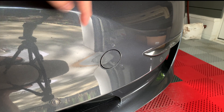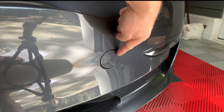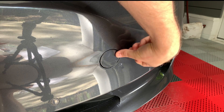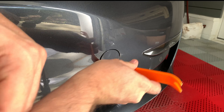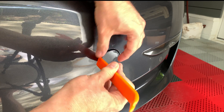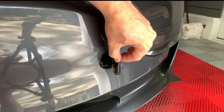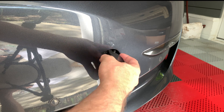Go to the front bumper of the Tesla Model 3 or Y and press the round cover that's on the left side of the car. This is also where the tow hook would get attached as well as the emergency 12 volt connection to open the frunk. Press the upper right side and it should pop open. Sometimes if you haven't opened it in a while it may stick and you may need to use a little more pressure, or in my case I used a plastic pry bar.